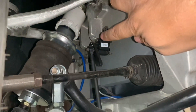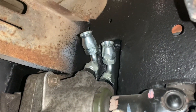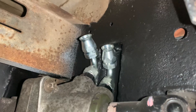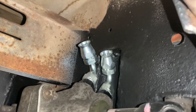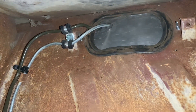Here we've got one of the wheel height sensors mounted for the AccuAir air ride. There are the two lines for the power steering rack. We had to relief cut the original subframe up front just to clearance that so we could get those 90-degree fittings in there. Here's some of the brake lines for the front, which run right up into the floor and up to the master cylinder.